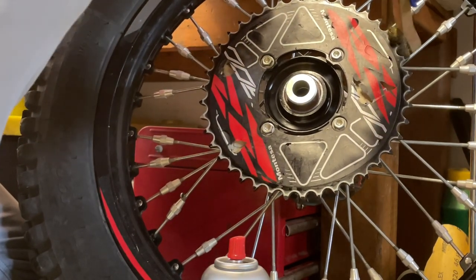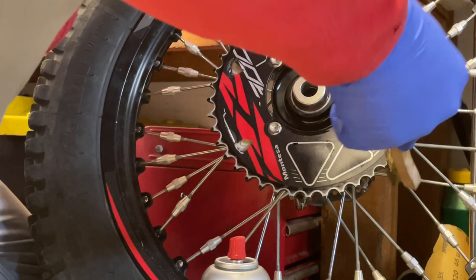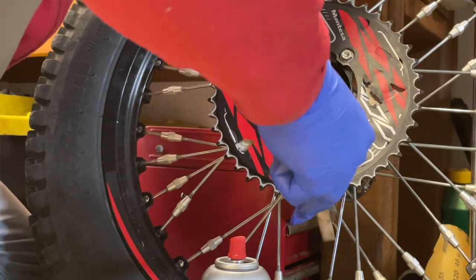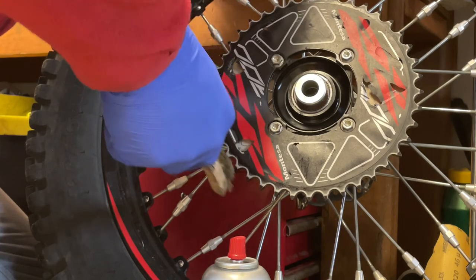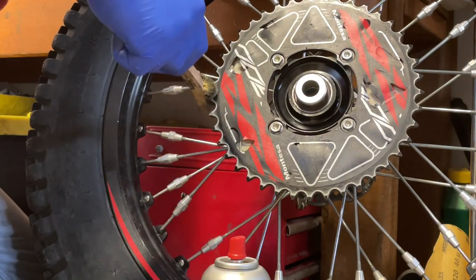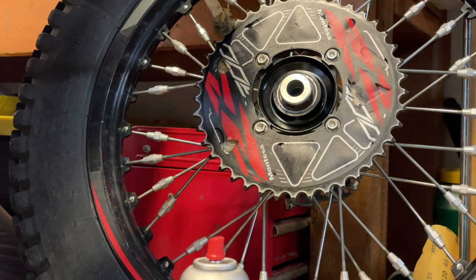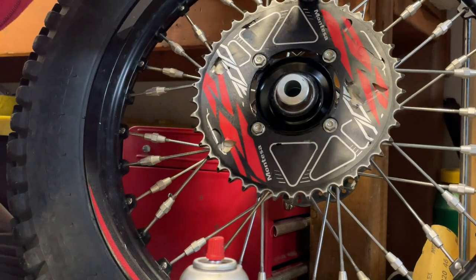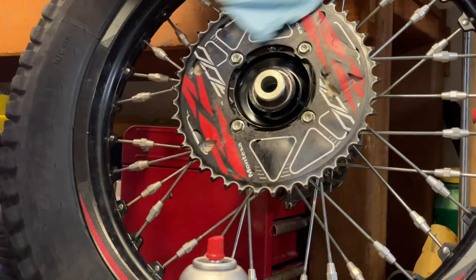and clean up those teeth, and I put the nice fresh clean chain. This is going to be nice and clean as well, so I'm not fighting with the garbage, dust, mud, old oil. I really like to clean the chain. I do it quite often. Some people prefer not to do it, but I think that if you clean it, you can see any damage, and also you extend the life of your sprocket, because if the sprocket has a little bit of dust or sand on top, it's not going to go smoothly. But in this particular situation, it's a nice fresh wheel.